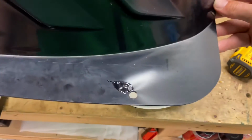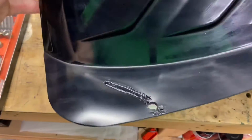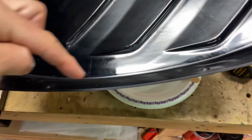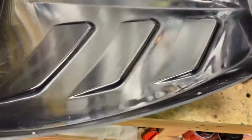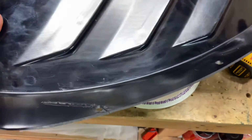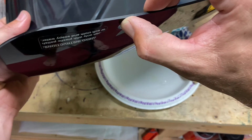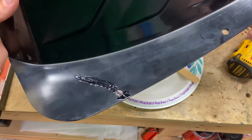Alright, so you can see it didn't take much. I've got it pretty well thinned out on this side and then this side as well. So it's really, really important that you let this dry thoroughly because this surface actually right here bolts to the main visor on the Nitro, or your boat, because if you're doing this to another boat it probably is the same way, but there's a seal that gets created right here, so the 4 screws actually connect this to the actual visor. So you better make sure this is good and dry. So this will probably take, I don't know, an hour or 2 to set. It says it sets within 5 minutes, but I want to make sure it's good and dry. So let's wait for it to dry now.